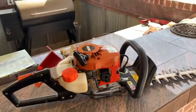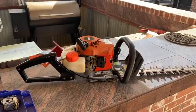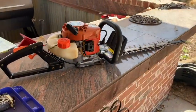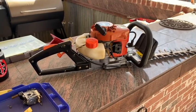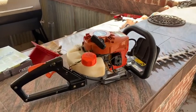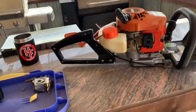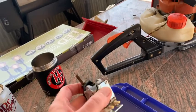The thing worked great, but I've probably had it five or six years, used it a lot the first two or three years, then got so busy at the farm. Same story as all my other equipment — I left gas in it with ethanol, and of course the carburetor just stopped working. I tried to fire it up, cleaned the spark plug, put new clean fuel in, blew out the air cleaner — same deal, will not work at all. So I actually removed the carb and did a little research.